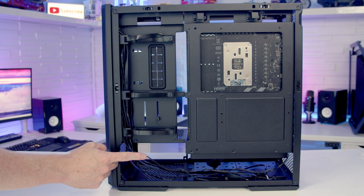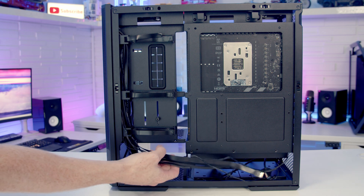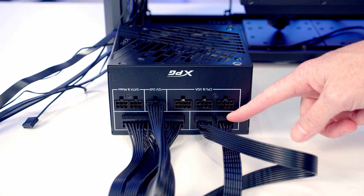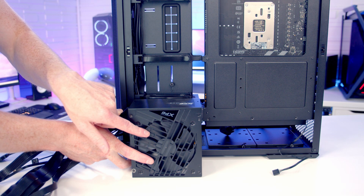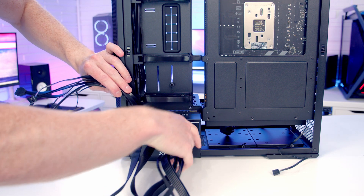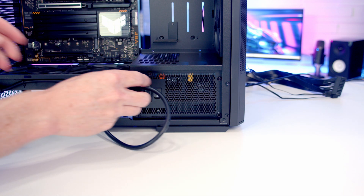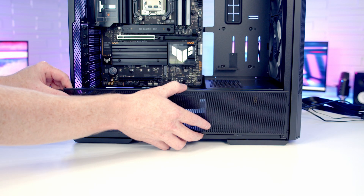Normally we'd install the case cables at this stage, but since they might obstruct the power supply installation we'll move them out of the way and install the PSU next. We plug in the cables we'll need: the 24-pin motherboard cable, two 8-pin EPS cables for CPU power, and the 12V 2x6 cable for the graphics card. With the PSU's intake fan facing downward, we free up the case cables, move them to the side, and slide the power supply into place, securing it with four large PSU screws. We then turn the PSU switch to on, plug in the cable extension, tuck the cable into the notch, and replace the bottom mesh panel.